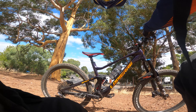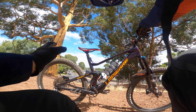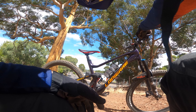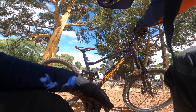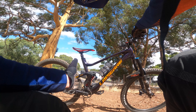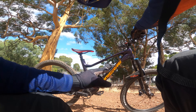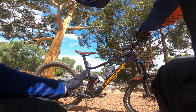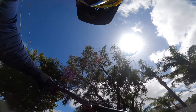Kind of modest geometry, not crazy geometry, but it works. It feels nice - lefts and rights, once I fix that handlebar roll, felt nice for sure. Long cranks - it's the only thing I'm not really enjoying. I could spend more time setting that rear up, playing around with the spring rate. I'd put a Fox spring on it for starters - nick that Rock Shox spring off and run a Fox spring, just for the lighter setup. The 300 spring is like a 350 Fox spring. Anyway, enough jibber jabber - that's one lap on the Spicy. Thanks Cow, cool bike man. Hope you enjoy it. Does a mean wheelie too - this thing's killer.